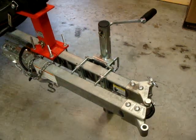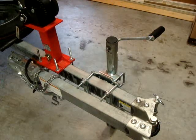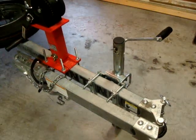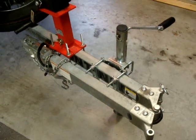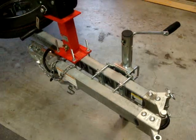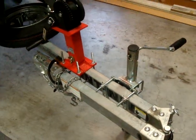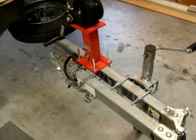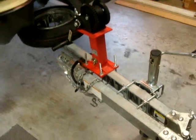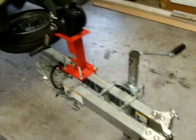That fix is just a hinge. I took three feet of length off my tongue and folded it back, and now I'm at 12 feet total length between the back of the motor and the front of the trailer. So it's only 12 feet of space I'm now occupying. But when I go to back the trailer down, I've got three more feet of clearance between the rear tires of my truck and the lake, and it gets my boat trailer far enough into the water where I can almost drive it right up on the trailer with the outboard. I don't have to worry too much about getting my feet wet — I just come right over the front of the boat, hop down on the trailer, winch it up, and I'm gone.